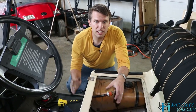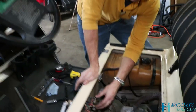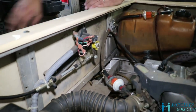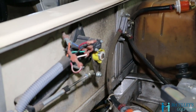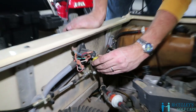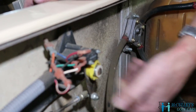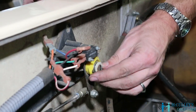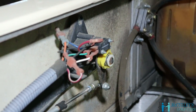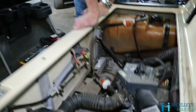Here's a quick tip. Anytime you're working on a Club Car, especially on the Club Car DS, there's a yellow switch right here. When this is in neutral, you push the gas and it will not go — nothing happens. But when you're working on it, you don't want it to drive off on you. So you can turn that over 180 degrees and this pushes up that switch, so even in neutral you can push the accelerator and test out your engine.